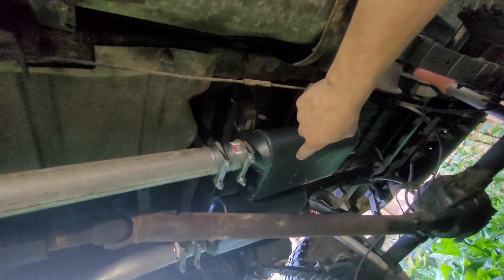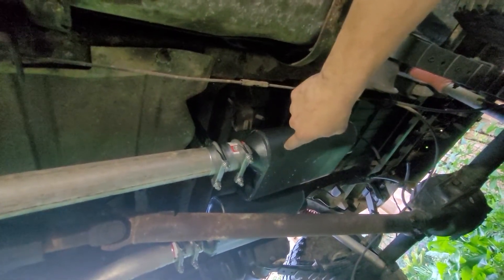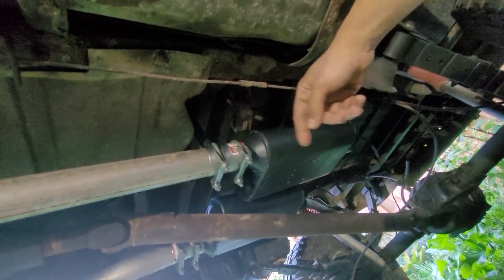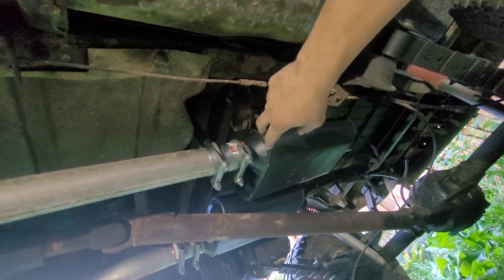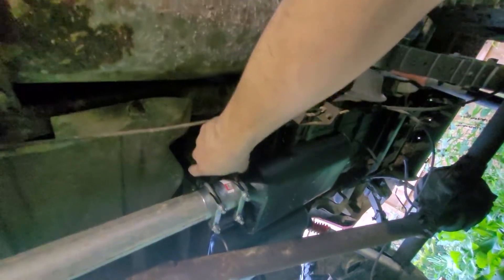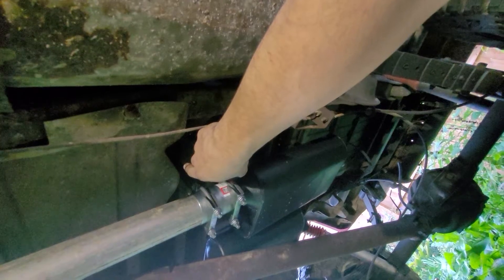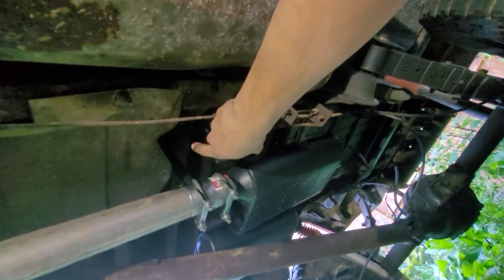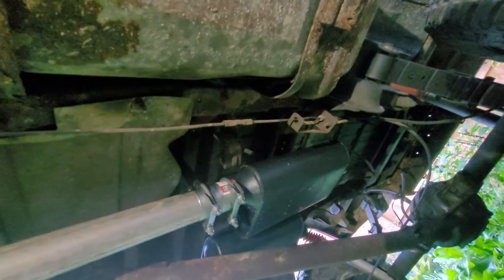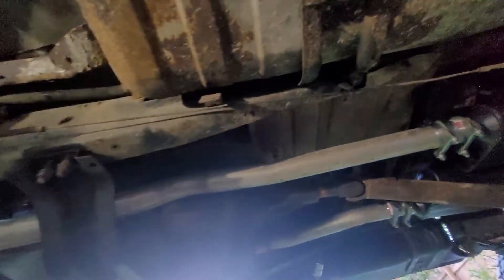The Super 44 Flowmasters are inner 2.5 inch, same as the pipe. So I could slide the connector onto the pipe and slide the Flowmaster on top, then clamp them up. I got an exhaust hanger on this side of the bracket and tied it into the frame itself. Drilled some bolt holes and tapped them in. That's all done — the truck sounds much better.